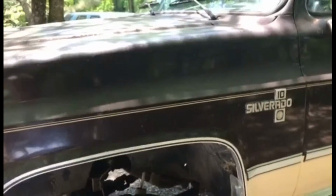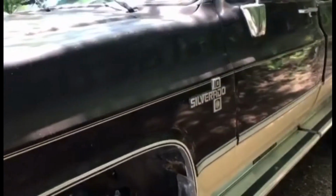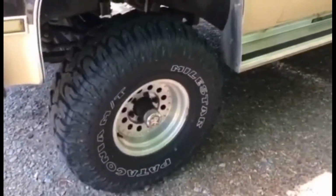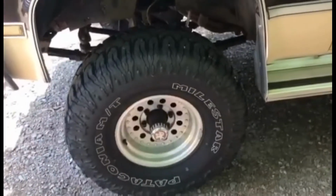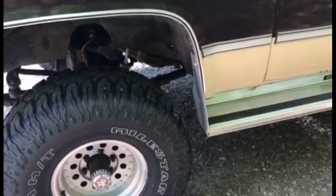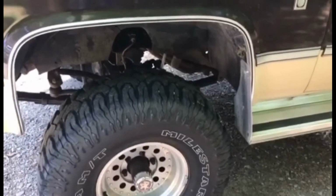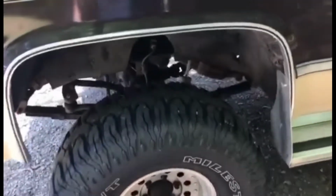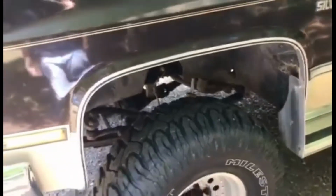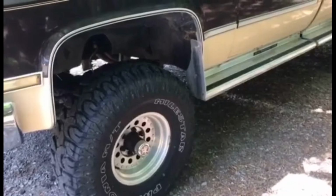I've looked at reviews of different lifts, and I've talked with people with different lifts. I know a few guys that went with Tough Country or Superlift, and they had a problem with 35x12.5s clearing with 4 inches. Now I can fit 37-inch Humvee tires and not scrub before I add my steps. So you can fit 37s on a 4-inch lift without rubbing. I don't know if that's a big problem for most people. It'd be a problem for me if I wanted to run 37s, but it was just absolutely uncomfortable to be up that tall for what I do, so I got rid of them.